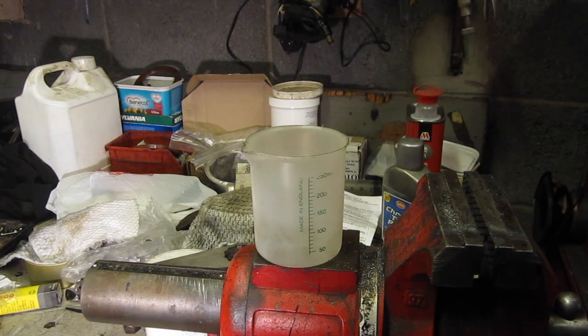Well, this is interesting. I've just been looking in the genuine Triumph factory workshop manual for the amount of fork oil. It says in all cases SAE 20. For the early Trident, the T150 Trident, it says 190 cc's. For the 73 model, no, sorry, for the 71 model year, well, I can't remember which, but one of the later model years, it says 230 cc's per fork leg.